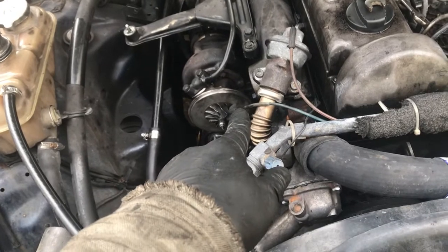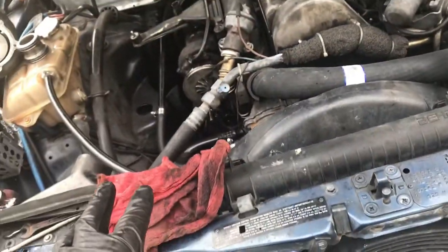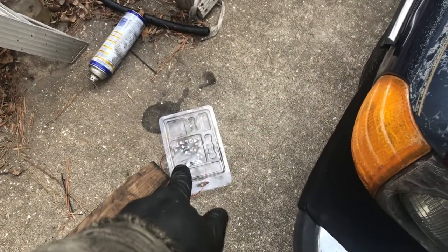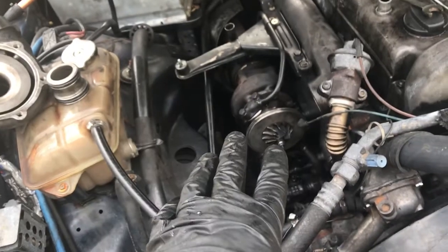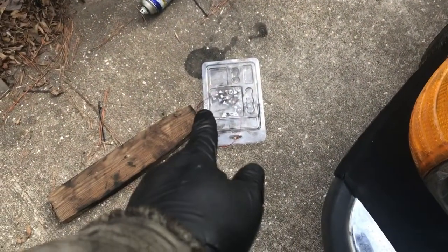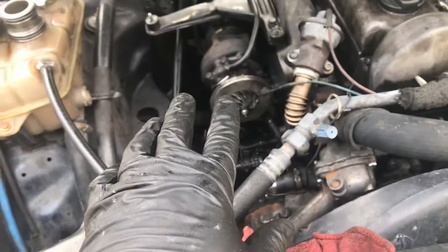And the bolt that was down there, I didn't round it off or anything, but you could tell where the open end had been putting pressure on it. I put that bolt right here at the top where it's easy to get to. And like I said, the turbo kit came with new bolts. I have no idea how good of bolts those are. The heads on these bolts are fine, none of them broke, and since they have lasted so long and didn't break off in there, I put them back because chances are those new ones are not as good a quality, and if I have to take this off again, I'm afraid one of those will break off. So we put the original ones back in.